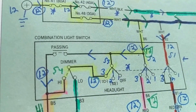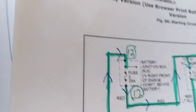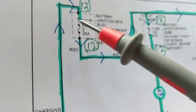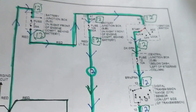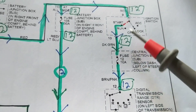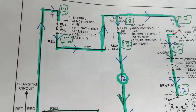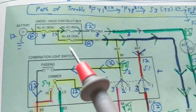That can be a little tricky at times. Sometimes diagrams do tell you the name — you might see a 30-amp fuse with its location noted. Other times it says ECM or PCM. That's something we just have to incorporate and get used to.